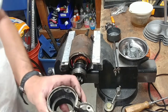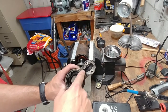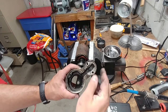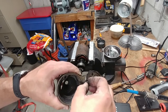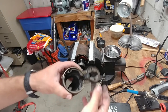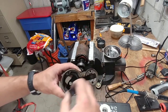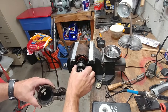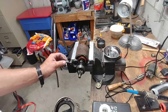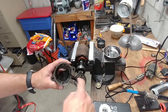From the outside those two starters literally looked identical. The Slash 5 starter has a little insert here - it's a metal, coin-sized round disc lying in here - and on the other side is rubber. On this one it looks like they just went cheap and put a little piece of rubbery rubber stuff, but it does the same job. Here is your gear mechanism with a spring and all that. The fork is also different - this one slides onto a ring and on the other one it grabs onto two little tabs. This slot here is where the fork runs.